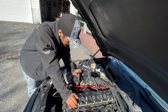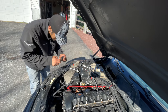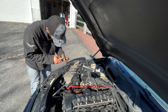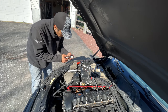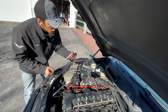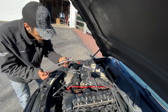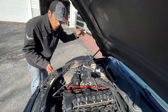Finally got the injectors out, but I thought I hit record and I didn't — so when I went back the footage wasn't there. Cylinders four, five, and six already have the new injectors in. I just have to put one, two, and three in. The ones I pulled off — I thought they were Index 11s from XDP but they're actually Index 12s. They're still pretty clean, seals are still good.